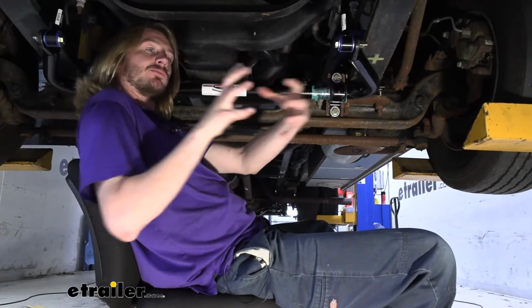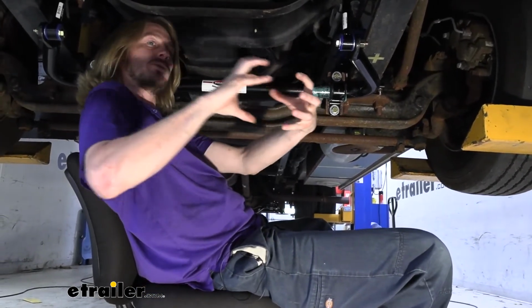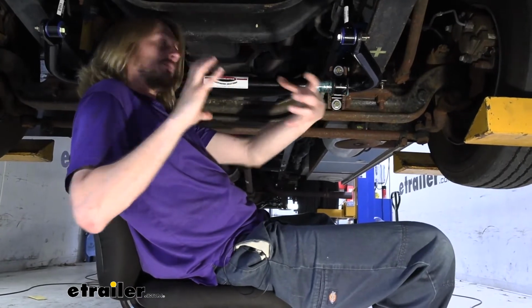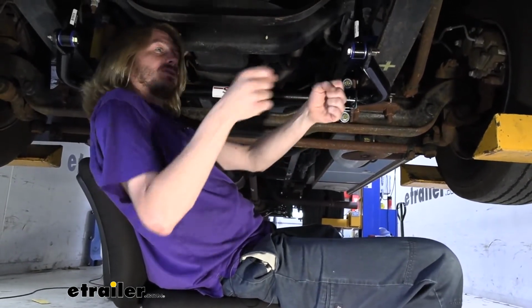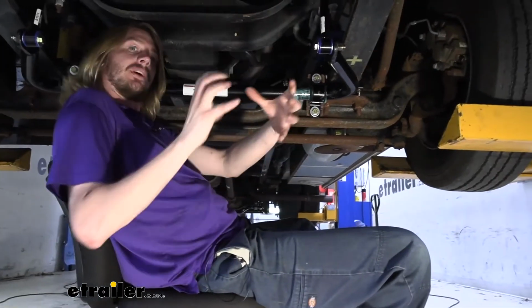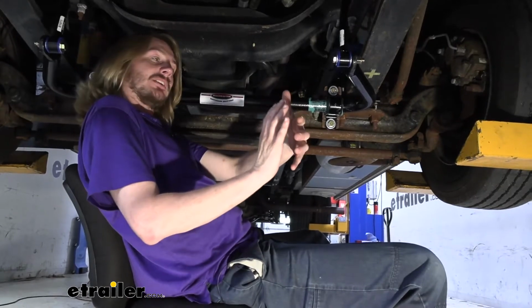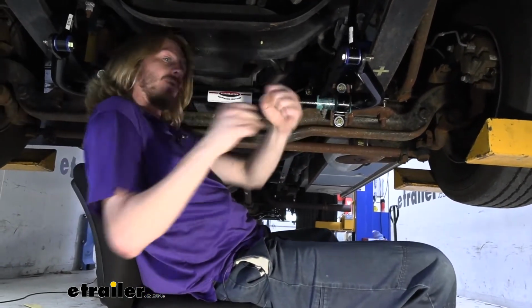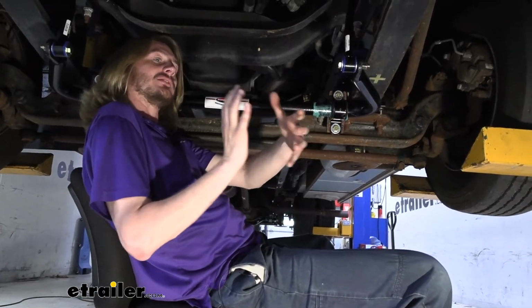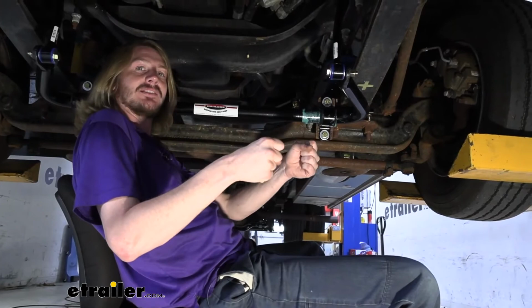There's a gas shock absorber inside of it that will help reduce how much it jerks the wheel, and there's also a coiled spring on it that, when set up in the straight ahead position, wants to return to that position. So if it does jerk the wheel to the left a little bit, the shock will dampen it, compress some, but our spring is also going to either compress or stretch depending on the way the wheel jerks. And that spring is then going to push back to return to its normal resting position, which is going to help bring the steering wheel back to center.